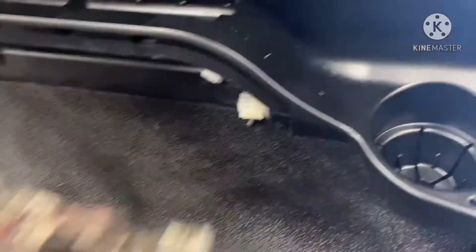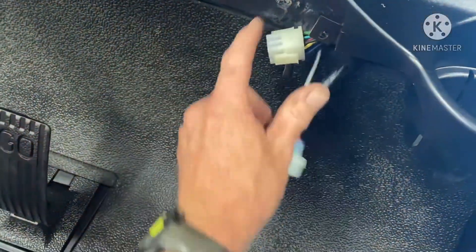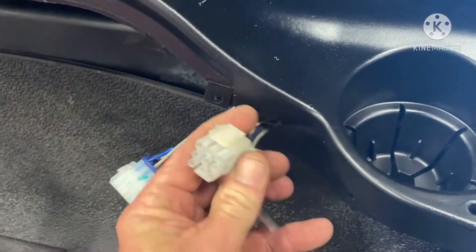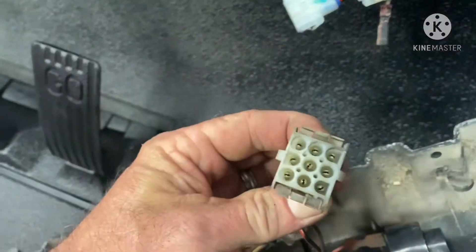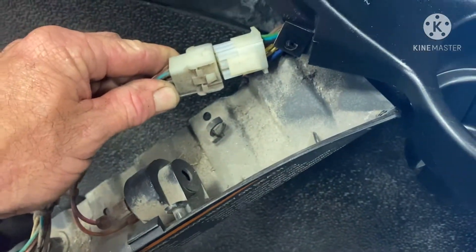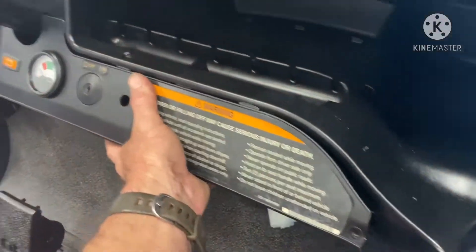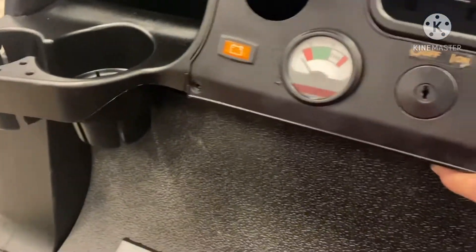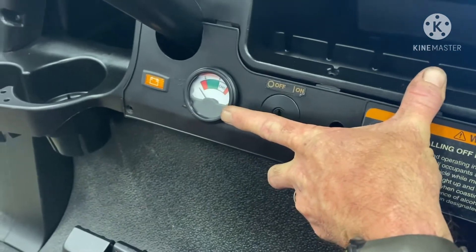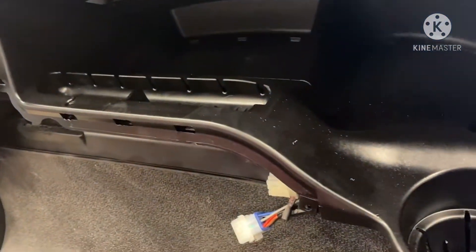So essentially what's going to happen is - I've installed a bucket harness on this car because we're going to be installing lights - but this is your main wiring harness with your car. It'll plug into this 12-spade connector here, so it just plugs in and that disconnects all the power from the car. Then the dash slides up underneath and goes there. Here's your meter - when you turn the key switch on, that meter will show where your charge is at. Very simple to do.